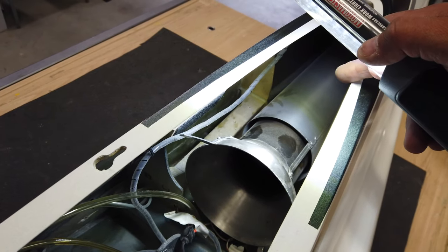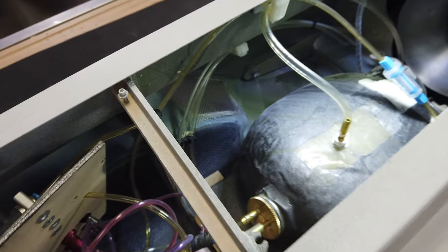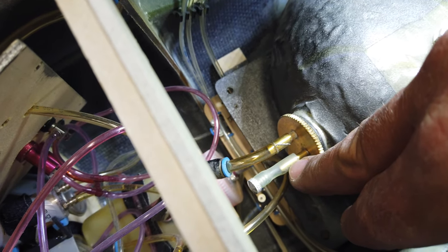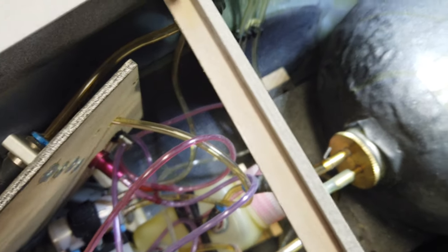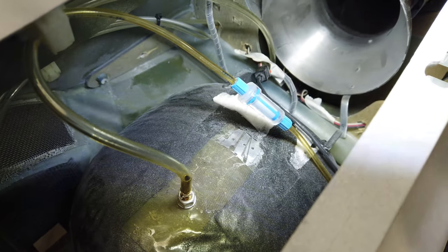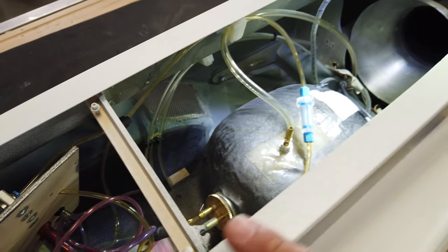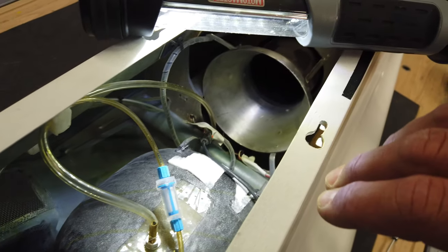We need to pull the pipe out of the plane just to get access to the rear end. When I'm given a project like this, I'm going to go through everything — I'm not going to leave flexi tubing that's not lock-wired, leave a single-wrapped safety line when it should be double-wrapped, skip checking the tank's clunk system, or leave a crappy Festo filter that could crack. I go through the entire plane unless the owner says to leave everything as is. Everything needs to be inspected.